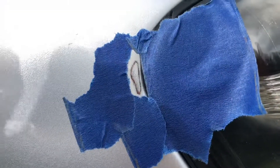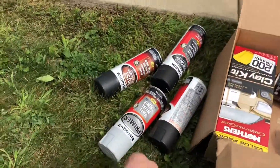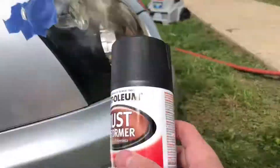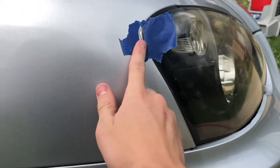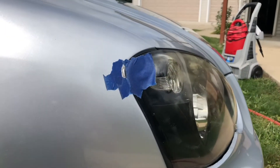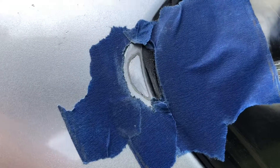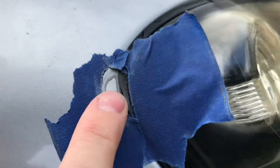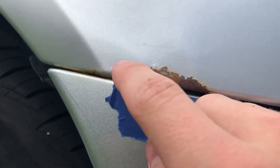Okay, it's not fully done. I got rid of the outer rust — I'll spray the rust converter over it, then prime it, then paint it. After that I'll sand it and paint it again with the color match, then clear coat. Same with the other spot. I just got done sanding this for about five minutes — it looks good now, no rust spots, just bare primer. It's all nice and smooth.